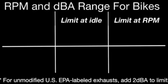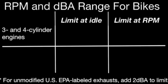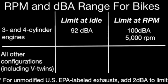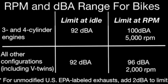Then we have another part of the test at an identified engine test speed, and that's dependent upon the vehicle. If it's a sport bike, since sport bikes rev much higher, it's idle and 5,000 RPM — that would be for a four cylinder. For a twin cylinder, a V-twin, it's idle and 2,000 RPM, which is just above idle really.